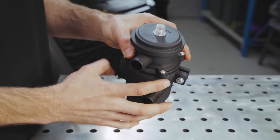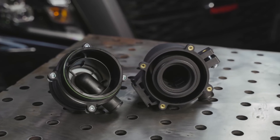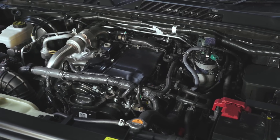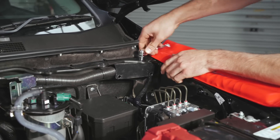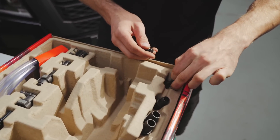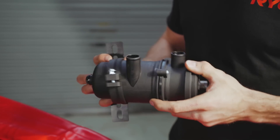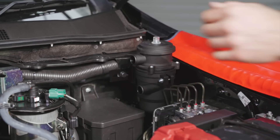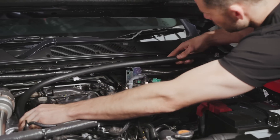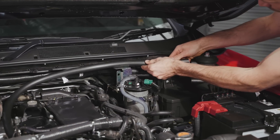Now that I have planned everything out, it's time to install the RCC 360K catch can into the vehicle's engine bay. To install this, I've had to drill two holes in this location here and mounted the catch can bracket using the nut and bolt supplied in the kit. You can now insert the catch can into the bracket. With this in place, we can work out the correct lengths of hose needed. Also make sure you provide enough slack in the hose to allow for engine movement. You can adjust the orientation of the catch can ports if needed.